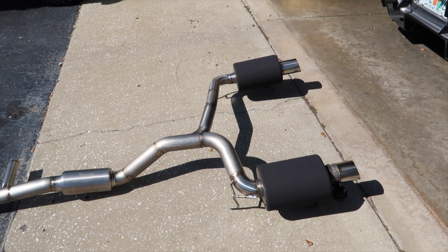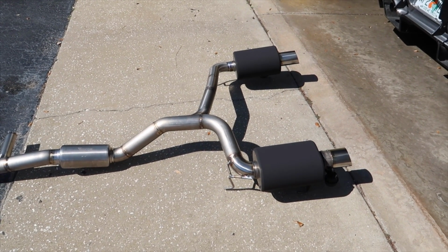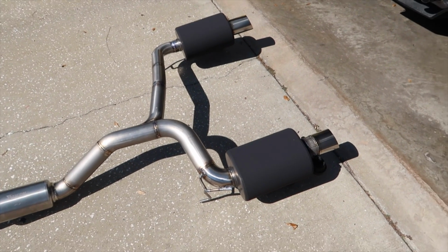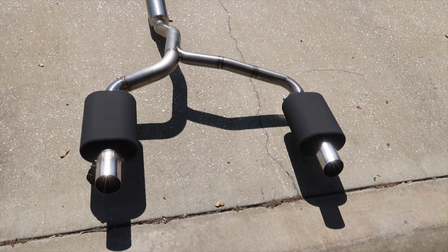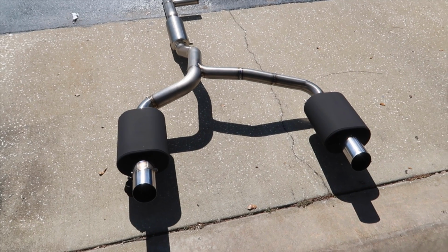So this is going to open at 4 psi, but it shouldn't restrict it until it gets to the upper 300s. Based on our calculations, the boost valve will open way before 300, and it'll be instantaneous going out to the 3-inch exhaust, but it should remain quiet, drone free, and pleasant to drive at boost.